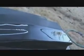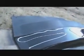Color sanding. Okay, I'm hoping I might have myself a system here. I'm laying out the compound right along that inside edge so I won't burn it, and then doing that section. I've re-sanded this whole hood, put another half hour or so into it to make it flatter and nicer.